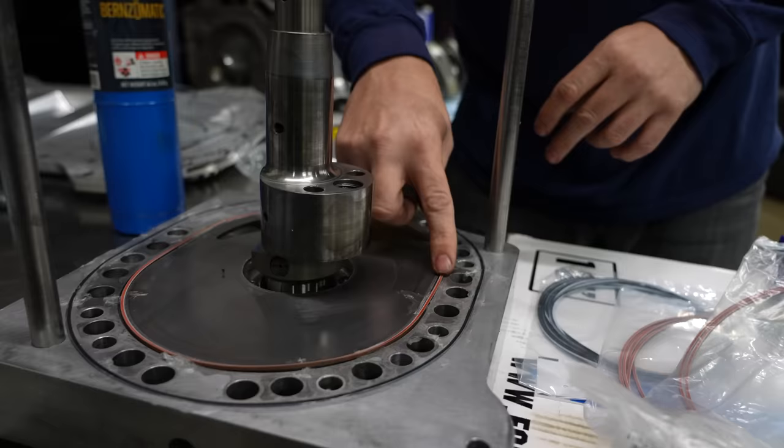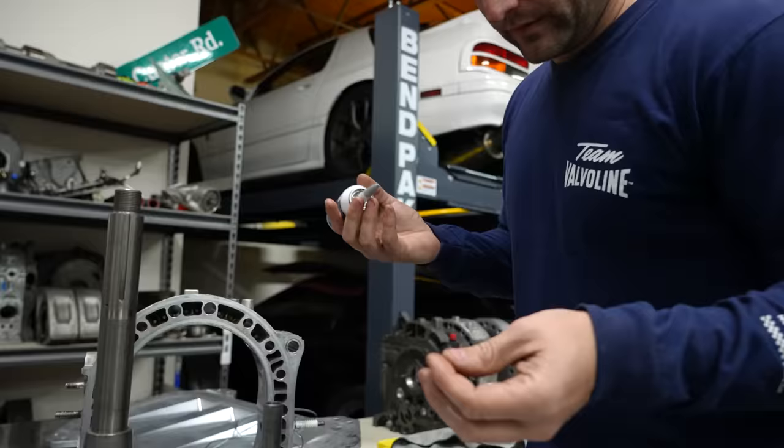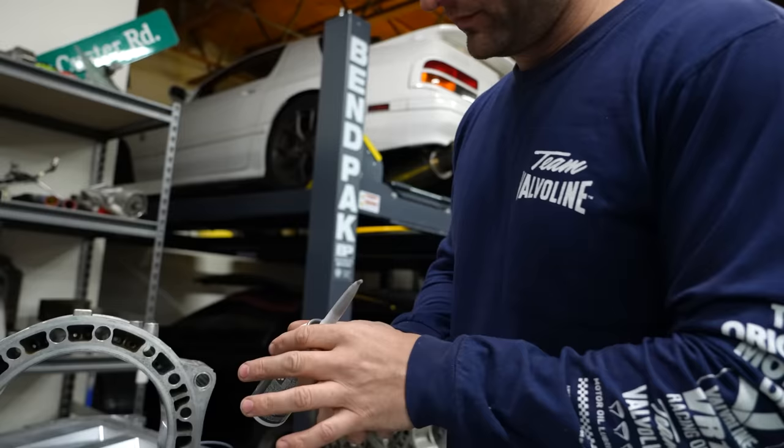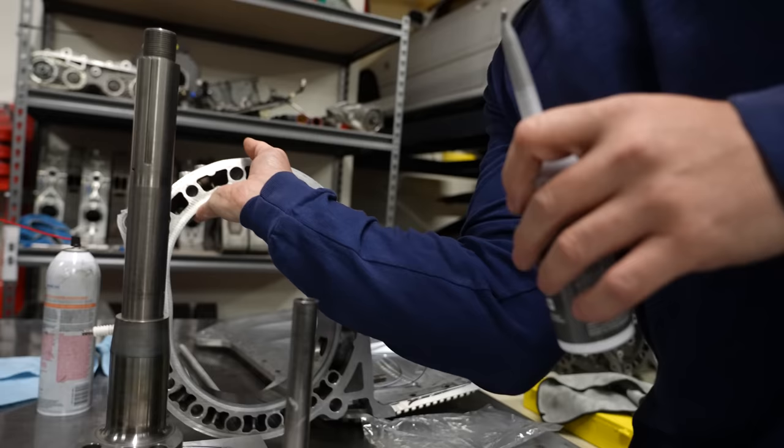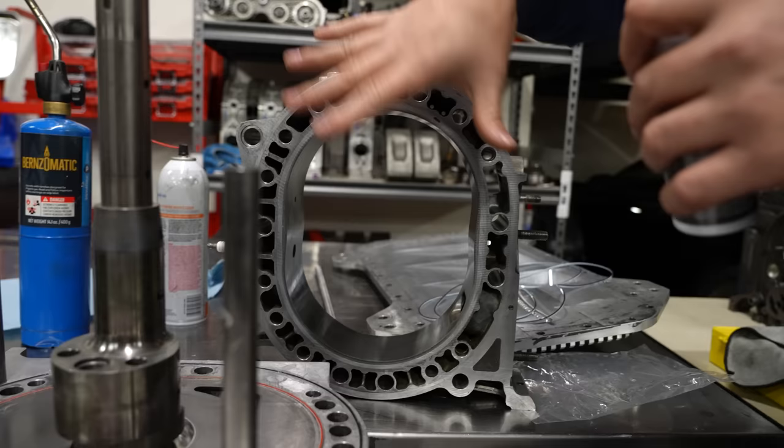Okay, this is rotor 2's housing. What we were doing is utilizing silicone for a couple of very important reasons. I measured the thickness, even when it's not set, once it's on the legs of this thing, and it leaves about a thousandth and a half of thickness. So I purposely put a little dab up here, and then on both legs, so that way it's square.